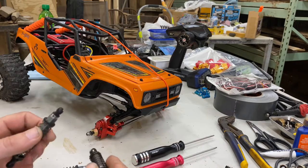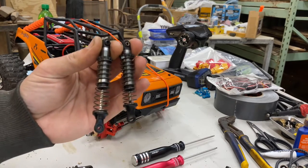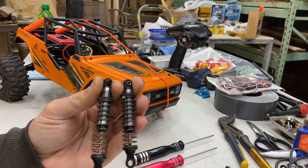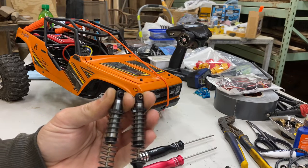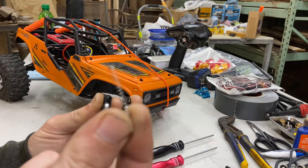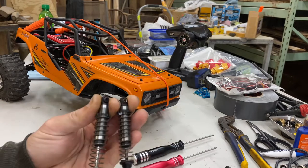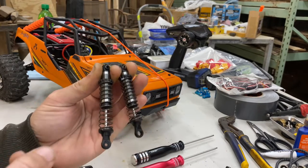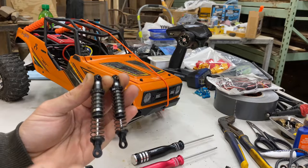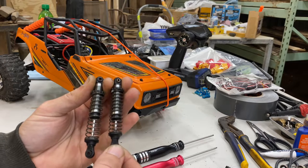Guys, I just wanted to show the difference between the completely sprung and the semi-droop. Over here, let's see if I can get these tore apart here. This shock here, I've actually got this tiny little spring underneath of the piston inside the shock body. So it's actively pulling the shock more closed rather than the traditional sprung, which is pushing it open all the time.